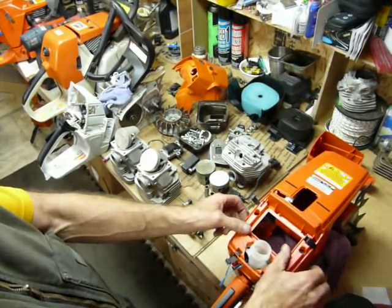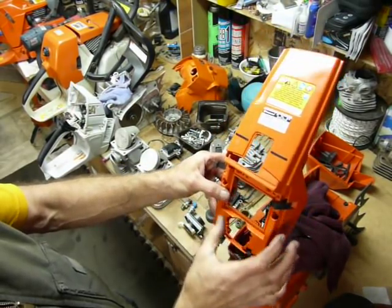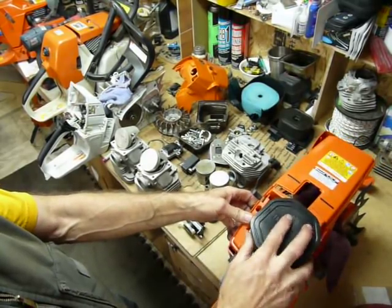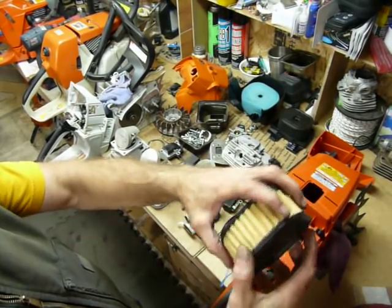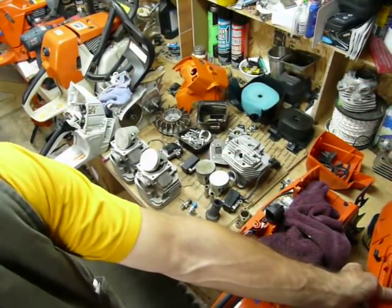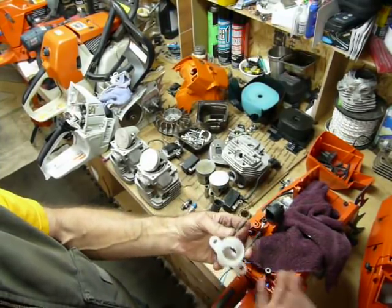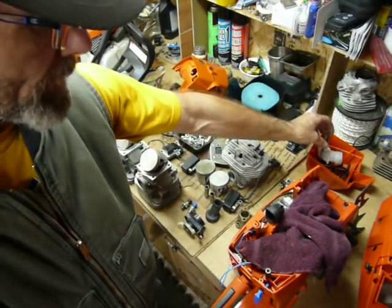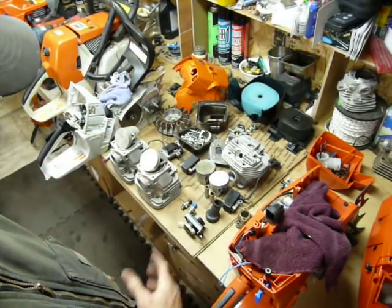The Husky's a little bit different — much longer cylinder cover. It's pretty narrow, and three screws hold it on, which is nice. If you look at the Husqvarna, you can see the air horn coming up through — this is what it looks like essentially when it's bolted up. Flock style, which is standard Husky. The air horn is kind of a velocity stack concept, except it's got a 90-degree bend, which doesn't help with performance, but it works pretty good. The Stihl basically comes out of the air cleaner as a pretty much straight shot into the carburetor.